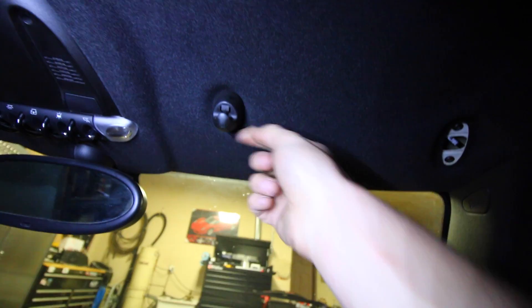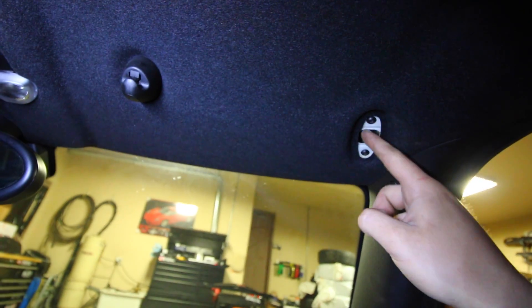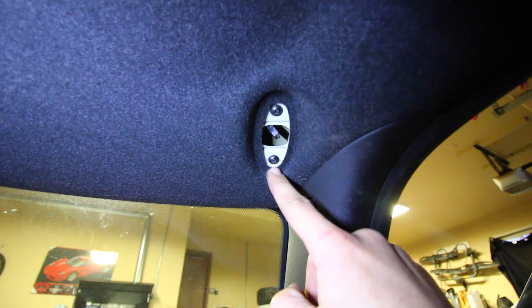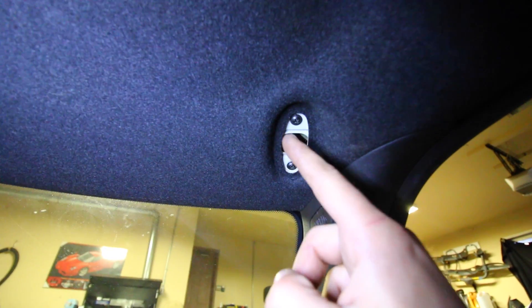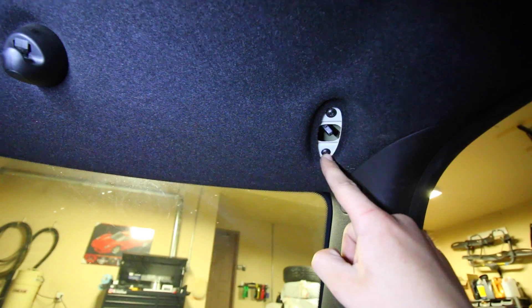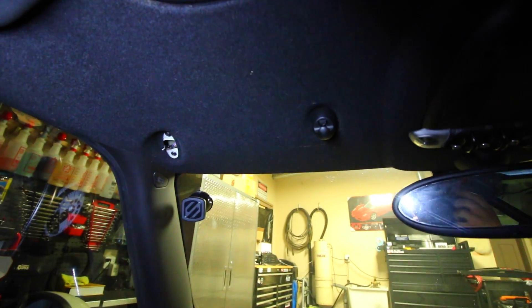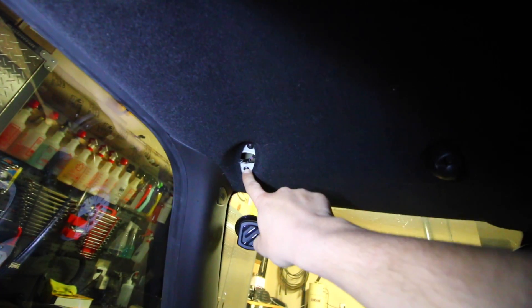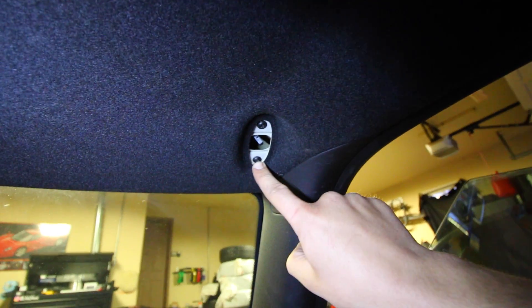There's going to be a little cover like this black piece that needs to be taken off from here and you're going to be able to see that there's two Phillips screws underneath that you need to take out. I already took the entire thing out and put those screws back in just to show you what's there, and you're going to have to do that for the passenger side along with the driver's side. So once you have them out you can put these back in and all you need is the spot here and here for the Wink mirror to go in.